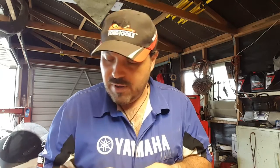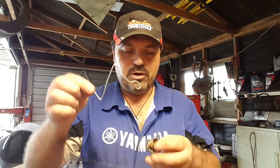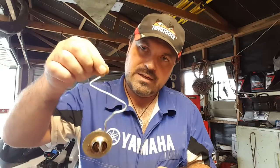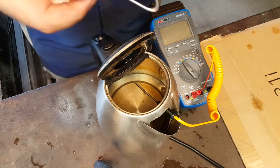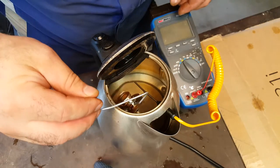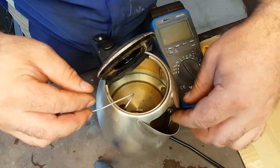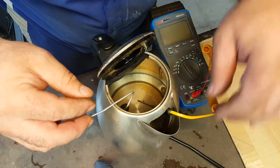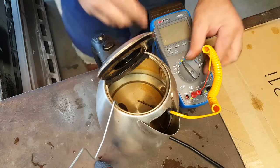I've made a little jig so we can hang the thermostat in the water without putting our fingers in — it's way too hot. We can now dangle it into the water. You can see the thermometer is also submerged in the water. It's really important that the thermometer isn't touching any sides of the kettle.